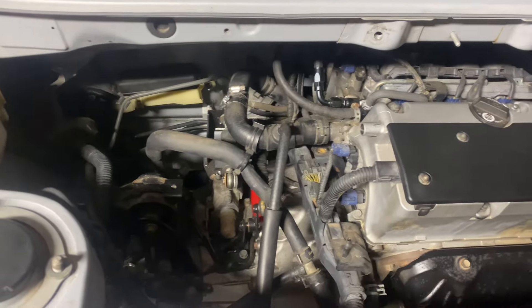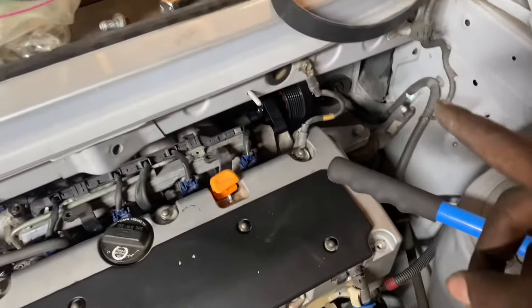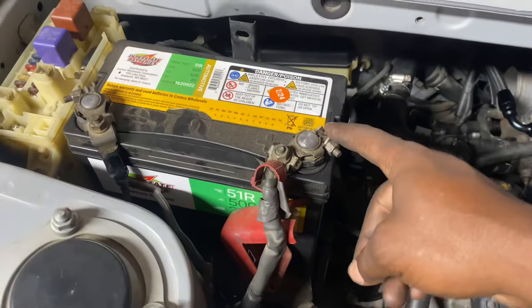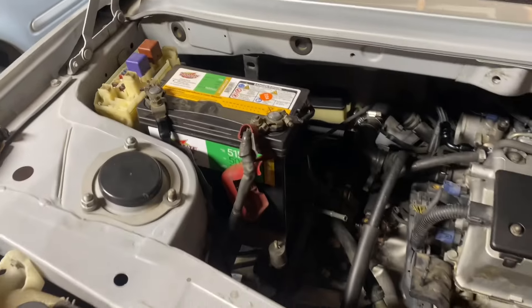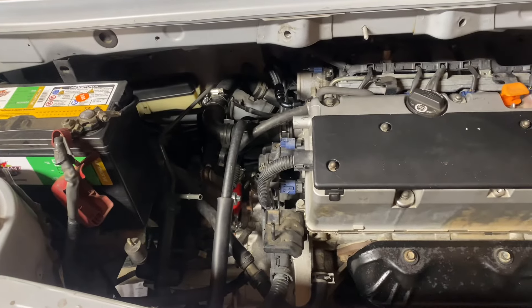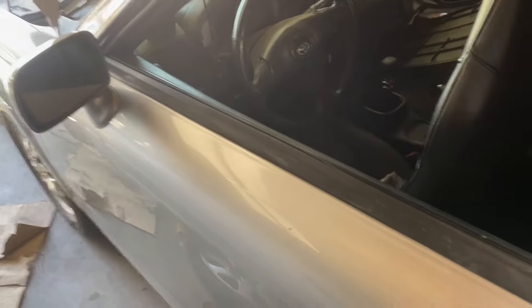Alright, we're back now and we got a lot of things done — got some grounds on here, transmission ground is done, wired up the immobilizer, and I got the power running from the starter to the fuse box. I didn't wire the multiplex and stuff yet — I just want to see if this thing starts up first. Give you guys a sound clip real quick before we go into the next video. This is the first time trying to crank it up, so let's see if it works out.